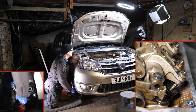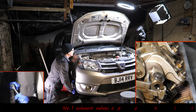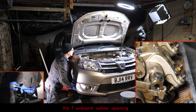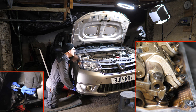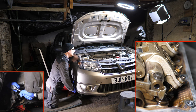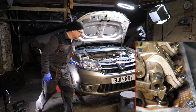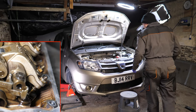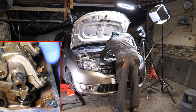I'm just watching the followers go down — it should be coming around now. There we go, it's going down, and then just make sure that's as fully down as possible before it starts to come back up. Okay, so that's now the engine set so that we can adjust inlet valves on cylinder three and exhaust valves on cylinder four.